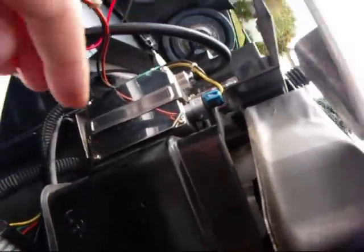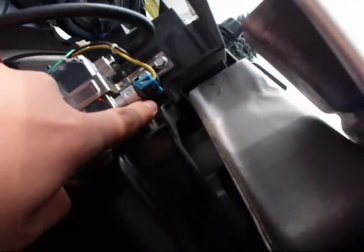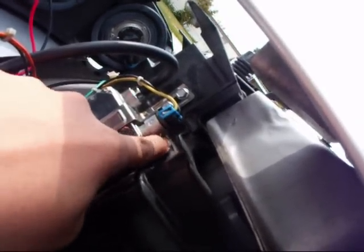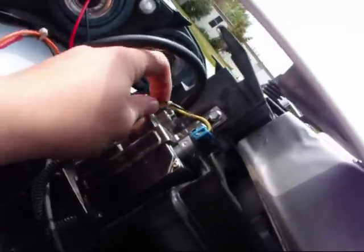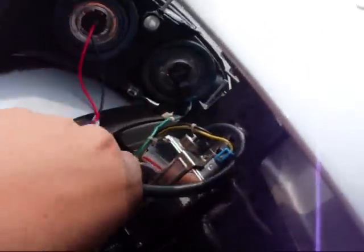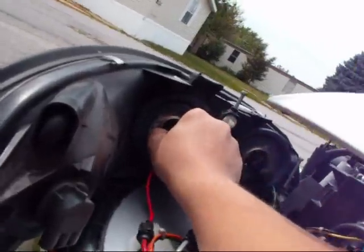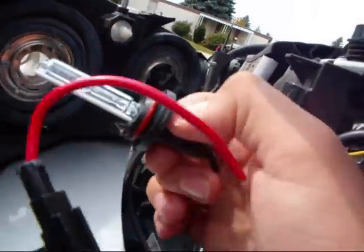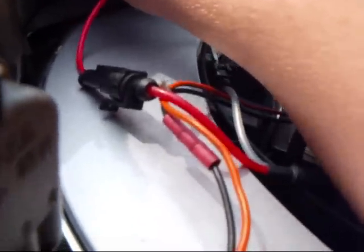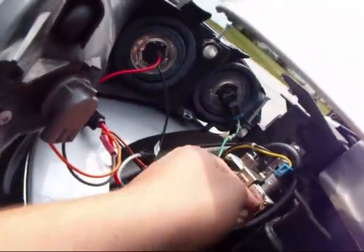The way these HIDs work is you have the factory headlight harness, and that goes into the plug right here. Mine personally — the clip that's molded onto this ballast is backwards, so yellow is positive and black is always negative. They molded this little clip wrong. The original headlight would attach to this, and you plug it into there, then the ballast has its own wire that comes out right here and goes to the HID headlight. It has its own clips, and the HID headlight just goes in like a normal bulb. You just turn it back in. That's basically how they're installed — it's really easy, all you do is mount this and plug everything up.